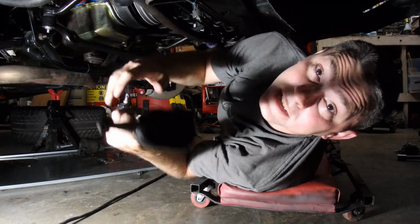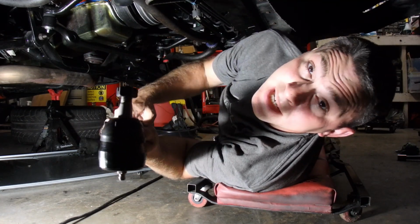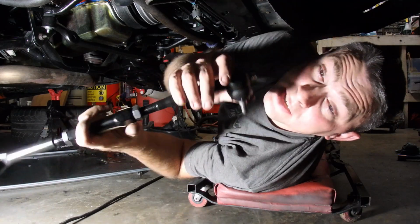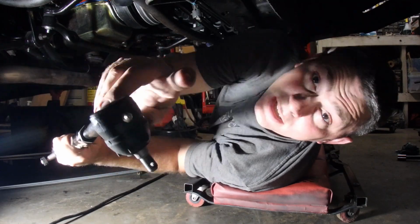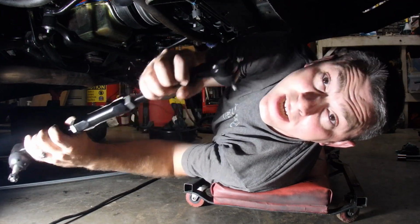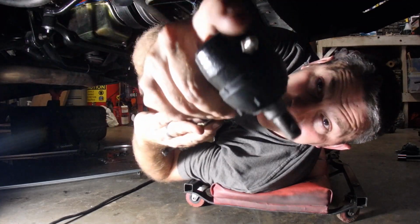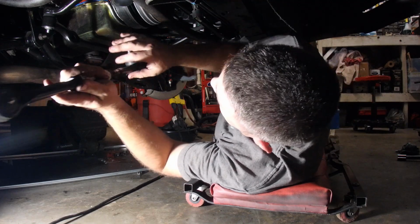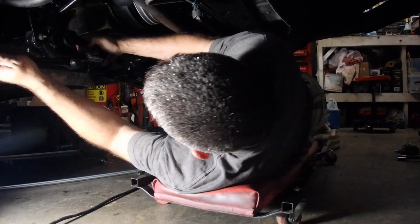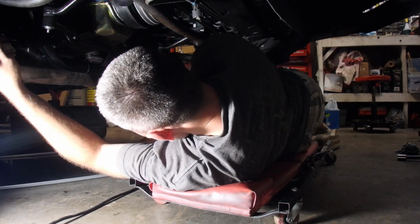Next, the tie rod goes into place. I already adjusted this one to be the exact size of the one that came out. The other way you can tell the inner from the outer tie rod ends is the outer has the Zerk fitting on the side, while the inner has the Zerk fitting on the bottom. This goes in from behind. One way fits all.